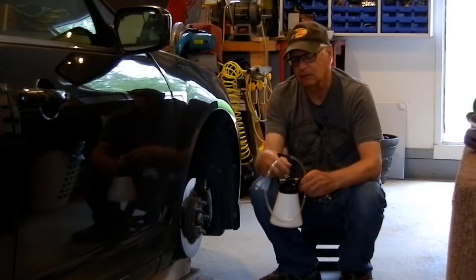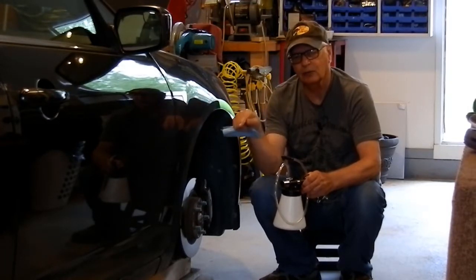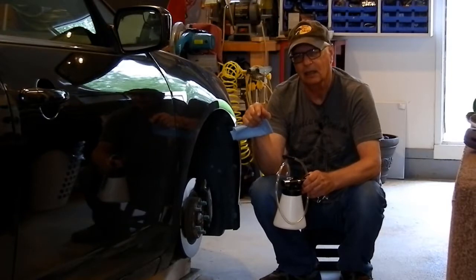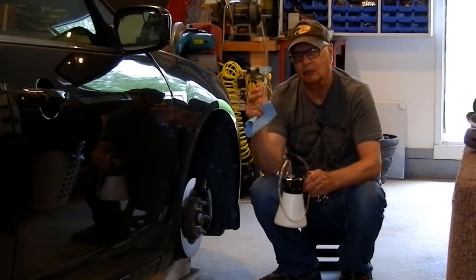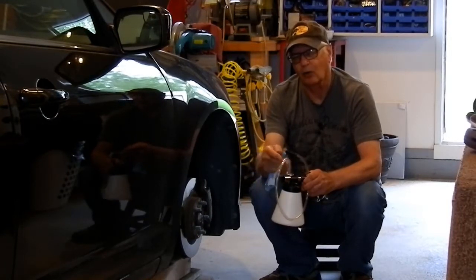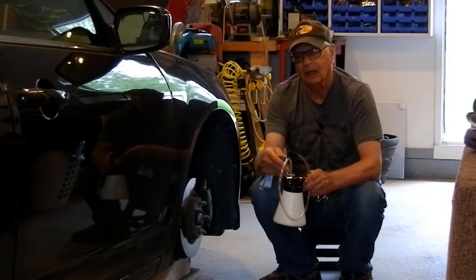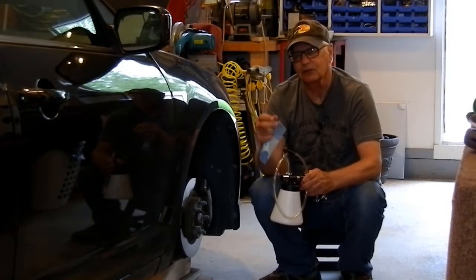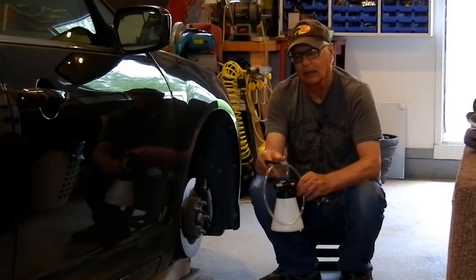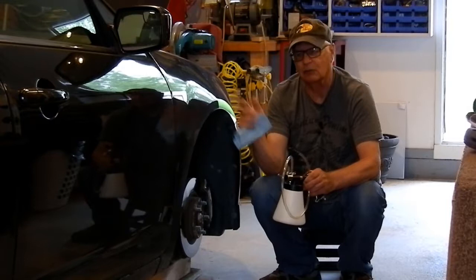I'm convinced that from the brake fluid reservoir down through the master cylinder, through the ABS module, down to the brake caliper and all your brake lines is at one stage brake fluid that has no air in it. Once you start getting all of the dark old fluid out and you see clean, clear fluid coming through, I think that any air that comes in is through the suction and it's happening outside of the brake caliper, and I wouldn't worry about it. And the true test of it all is when the job is all done, is the brake pedal is firm.